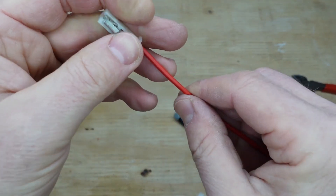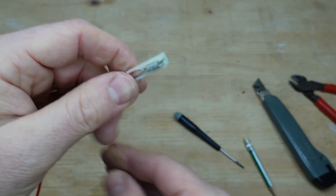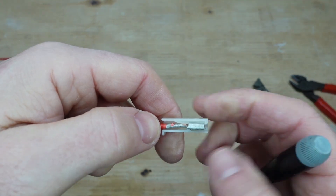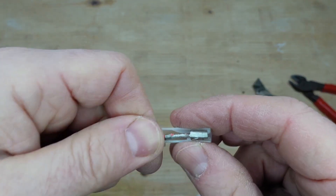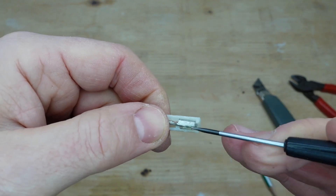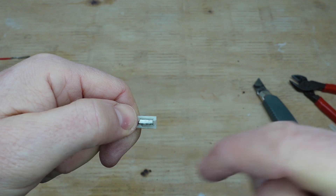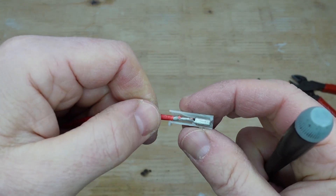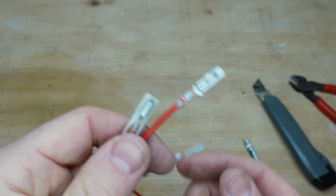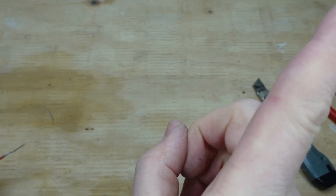If you've got a better understanding of how these go together, it makes taking them apart a lot easier. The main problem is people pull on the cable and act on the lug, which can bend it back on itself forming a hook — then it won't go forwards or backwards, making the whole thing much harder to disassemble. If you found this useful, please subscribe to help grow the channel.